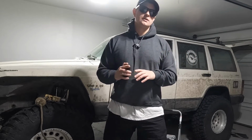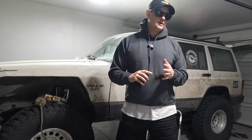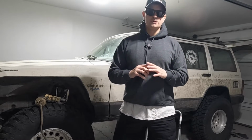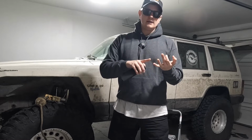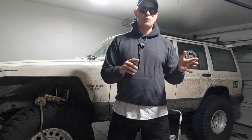These actually require you to bolt them to the top of the struts. Typically going to need to do a multi-link spacer or a trailing arm spacer. If you're not sure if you need trailing arm or multi-link, just hit up any reputable Subaru specific lift kit manufacturer. ADF, Rallytech, Primitive Racing, SLO, these companies, they all know what you're going to need.